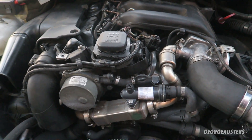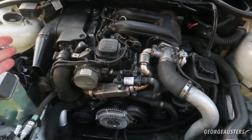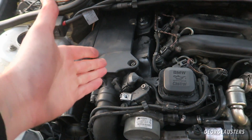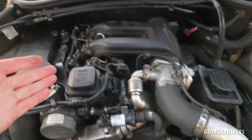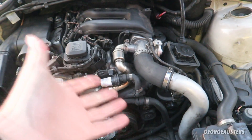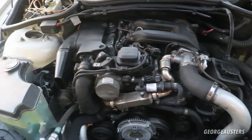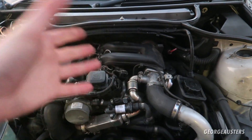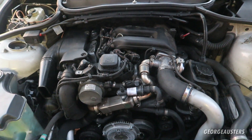I like to do it twice a year or so. And that's really the same for all of the other service items as well — stick a fresh air filter in every year or so, fresh cabin filter, fresh fuel filter, and do a coolant flush every three years or so. All these things are very cheap to replace, and if you do replace them regularly, it's going to ensure that your engine and your car continues running well for the foreseeable future.